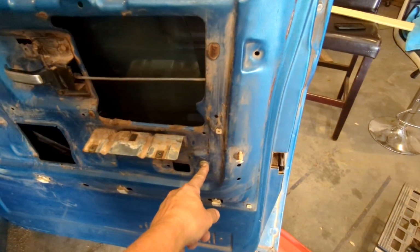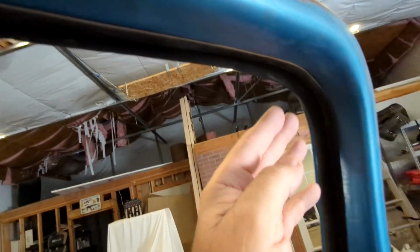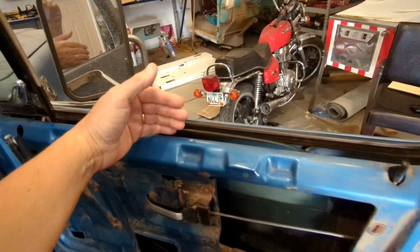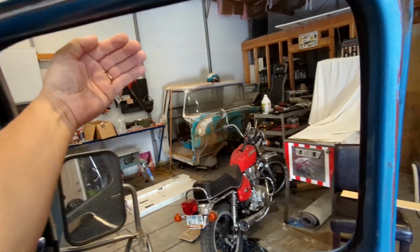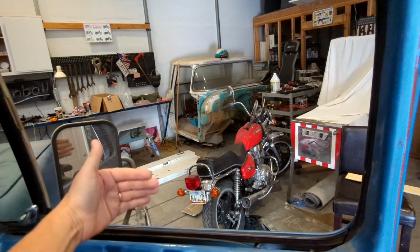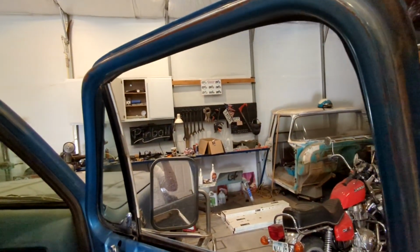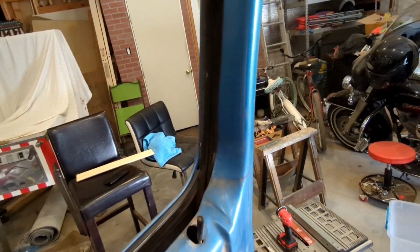It's just that it's this screw here, I think, in addition to the ones we got over here. But what it is, you've got this other channel felt that goes all the way around the window and down in here, that has to come out, because what you have to do with a window is roll it all the way up, take all the channel felt out, roll the window up. It has to run outside the door, essentially, and the only way to do that is not have the channel in it, and then you can disconnect it from the regulator because it actually rolls past the window, comes up out, the regulator comes out the top, and then you can slide out the window. But anyways, not a horrible thing if we have to do that. I'm just worried about this channel felt because it's kind of hardish, and I'm worried about pulling that out and it breaking and having to replace that felt, because I really didn't want to, is what I'm trying to say.